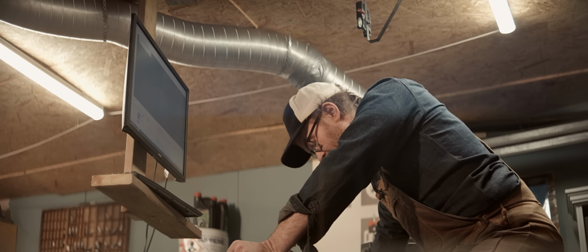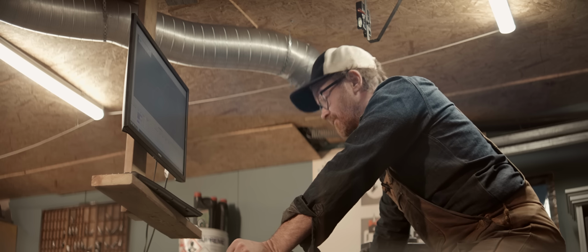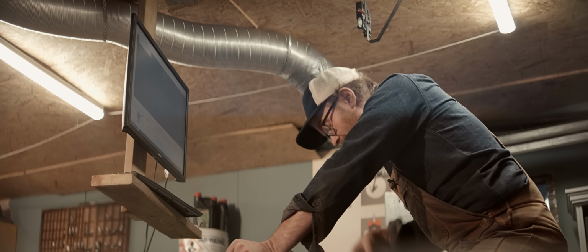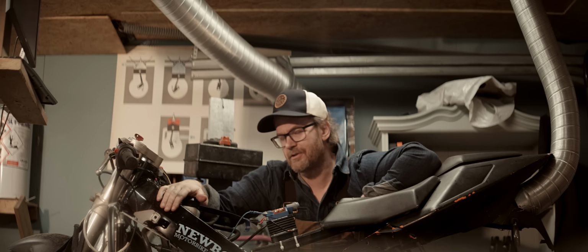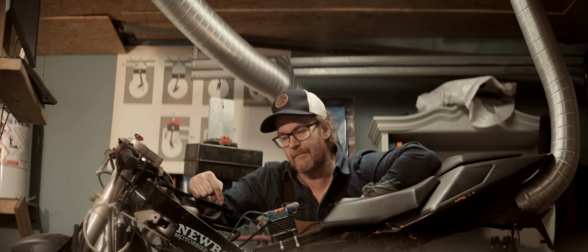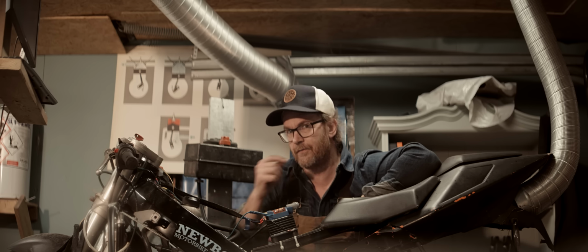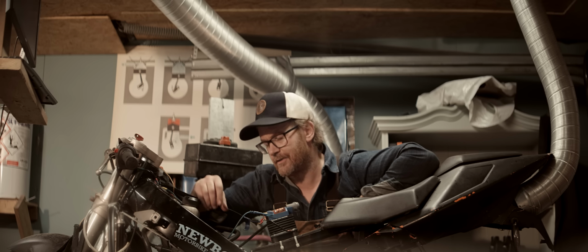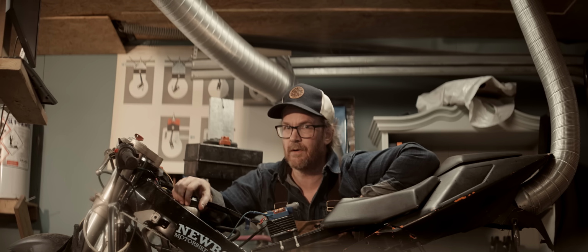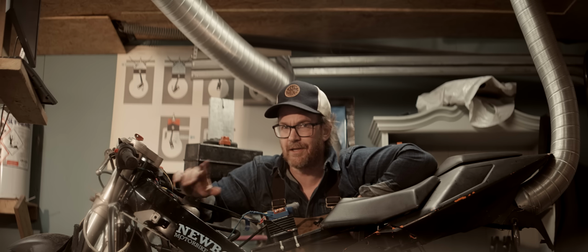And the nozzle is clogged, so we should be able to add lots more. We can run a different nozzle even, but it's not spraying like it's supposed to at the moment. So actually a success this time. Now it's just a matter of cleaning that nozzle and adding more nitro and see what happens. Replace the plug with a surface gap plug to see if that helps with the running on even though you turn the ignition off problem. Just see how much nitro can we pour in there and how much power can that get us. We've gained 1.3 horsepower so far, but I'll need to fix that nozzle. Okay, thanks for watching. See you next time.